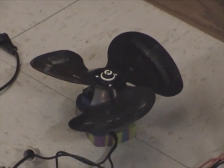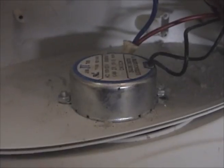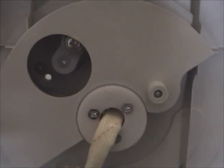I often think about taking a fan like that and building a homemade box fan out of it. But let's see if we can get this synchronous motor out of there. I can't get to the motor with those nuts - they're too close to the motor body. So I took the bottom cover off and removed three screws. I managed to haul the entire oscillation base off. The motor output was connected to a rotating piece that pivots on a shaft - it moves to one end as it rotates, and when it got to the other end the motor switched directions and went back. And there's the oscillation motor - what an odd little device.